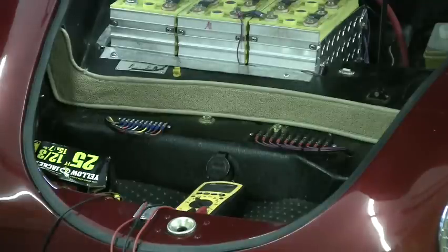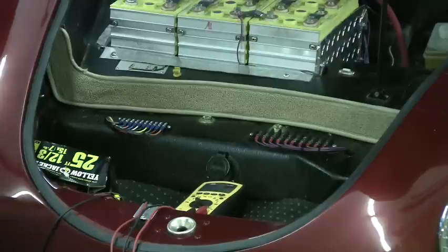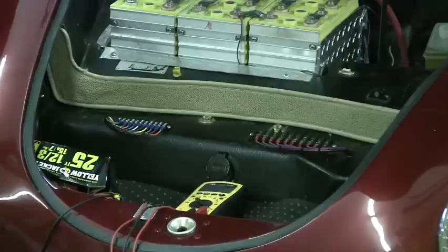When I have suspicion or just want to check, I go in and with a multimeter check each of the batteries — not each of the individual cells — to determine if there's a particular battery that's a problem. If there is, frankly, I'm done. I'm going to pull the battery. I might take a reading right at the terminals of the battery and check each of the cells, but more than likely, if it was anything significant, I pull the battery out of the car and go back in the shop with better test equipment. At that point, we would try to bring the cell back in line by either bleeding off some energy or adding additional charge to that cell to get it back in tune with the other three.